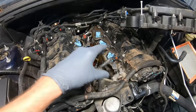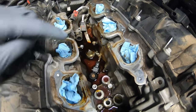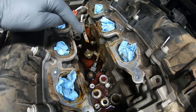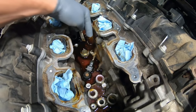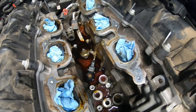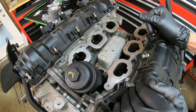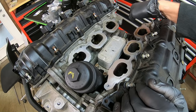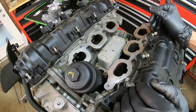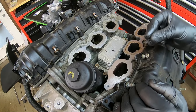You can't really tell if it's the plastic housing or the O-rings underneath, but oil starts accumulating down in here. As it accumulates, it pools up inside because both the front and rear areas are kind of capped off, so a valley is formed. Over a period of time, that oil collects and gets kind of deep, and then eventually it leaks out the backside on top of the transmission and leaks further down — that's when it's usually misinterpreted as a rear main seal.